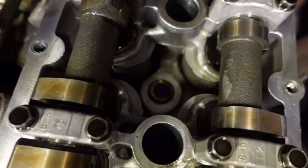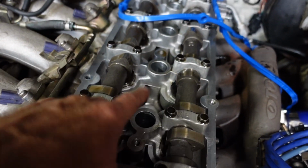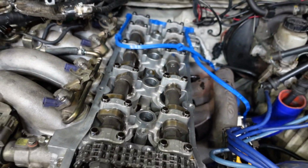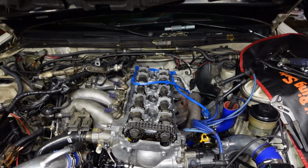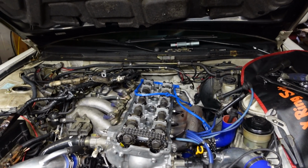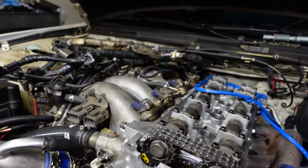I can't show you the oil down in there, it's a little too dark, but the spark plug in the number 1 well is completely buried in oil, and the spark plug in the number 2 well has probably the depth of the flange on the nut on the spark plug deep. Well, I'll set y'all back up in the sky now that y'all see how the distributor and the damper down there line up. I do have some timing marks here on the chain.